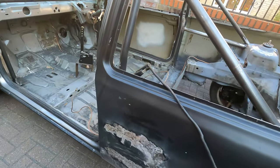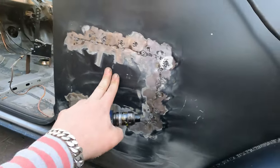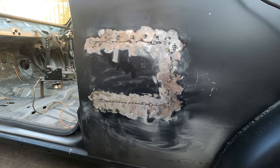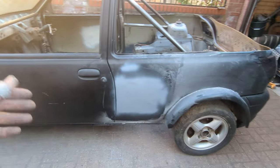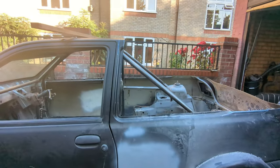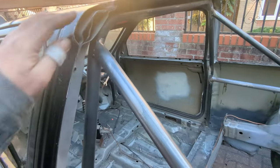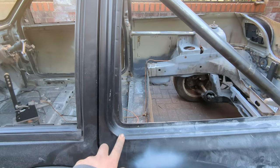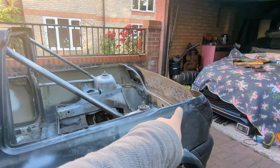More work - what I've done is chopped a bit of the roof to fill this up. This plate is strong enough; everything else I'm going to do with polyfill and stuff. I don't have the welding skill to fill all of that with weld. This will need more work as you've seen, but the whole body needs more work, so I'm going to leave bodywork to the end. At least the hole is patched - I've painted it back. I need to do a cardboard template that will fill that in and potentially try to weld something in there.